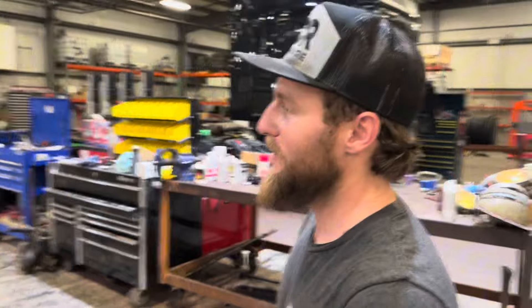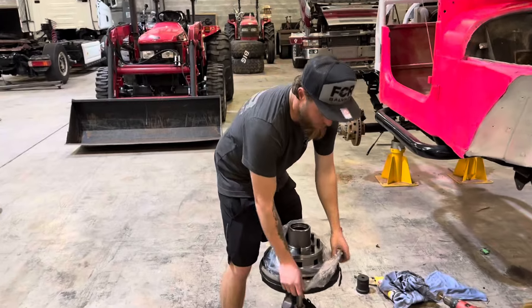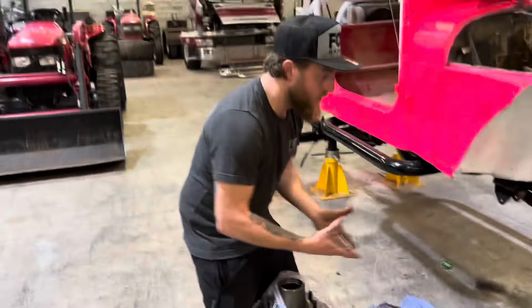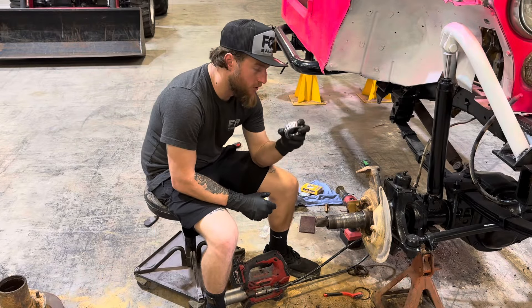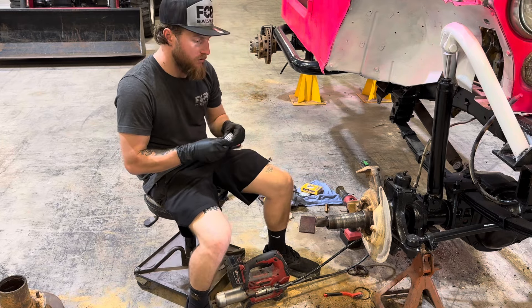Let's hop into this — I'm ready. So we're going to do the hub first. Let's attack this big project first. I've got to take that locking hub over to the parts washer and get it cleaned up for whenever we go to stick it back together. First things first, I need to pack the bearings before I put them into the hub. So let's get to packing.